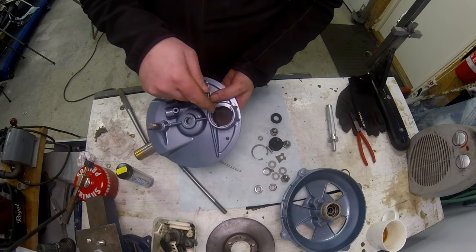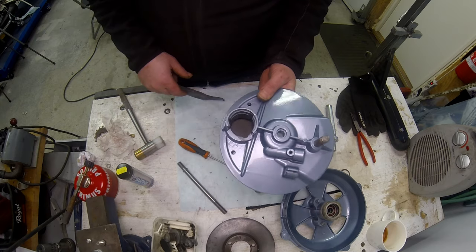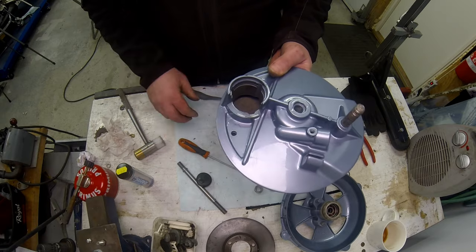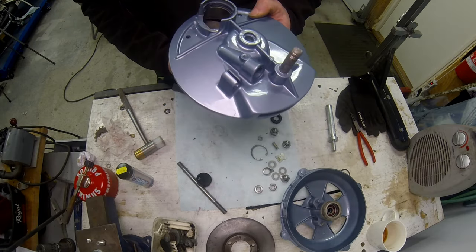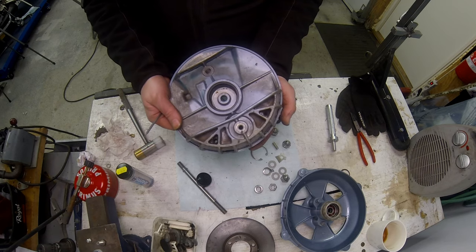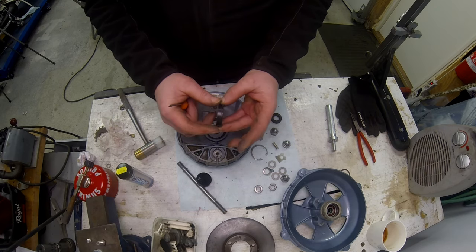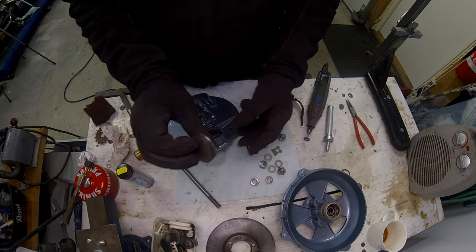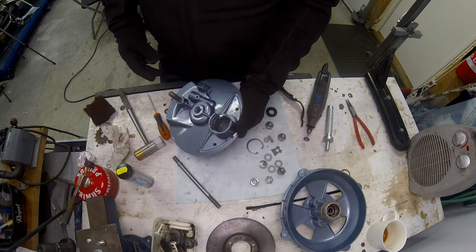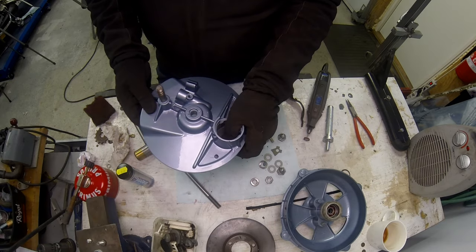The next job is fitting the pads. Reading Stickies' manual here, it says the modern type pads can be a little bit tight so you should take the radius off the edge because the paint is a bit thick. The pad doesn't actually fit in there properly so I'm going to have to take it out, take some emery cloth and take away the paint on the outside surface. Let's see if it will slot in - there you go, perfect, even a bit of jiggle room there as well.